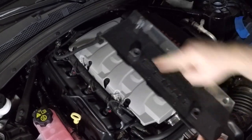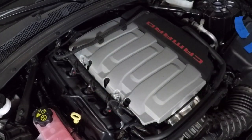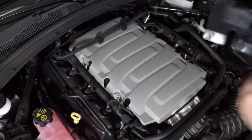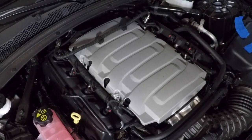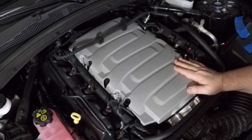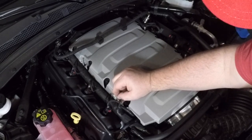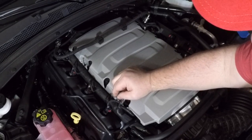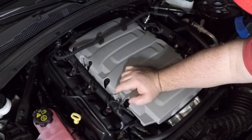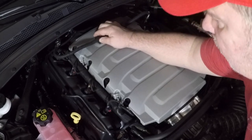These literally come right off. You have these two little grommet things that kind of sit on posts, and those come right off. The hard part is you've got to get these — they call them tree bolts — and you have to unscrew them. You need a deep socket 10 millimeter socket to get these off because of the posts. First, we're going to take off this hose; there are some really quick clips.